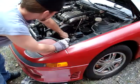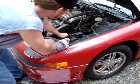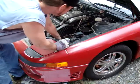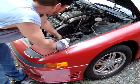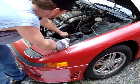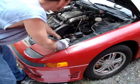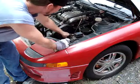And this is the time-consuming one. Like I said though, if you undo the motor mount, which is just a pain to me, I believe it does make it easier to get this bolt here with a regular socket. But if you're patient with this one bolt, it's definitely, in my mind, less of a hassle than dealing with the motor mount and then jacking it up. That's the only bolt I feel it's necessary to undo the motor mount for, this one here, for convenience. Although I do believe the manual says that you are supposed to remove the motor mount and bracket.